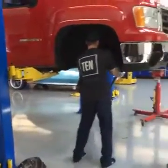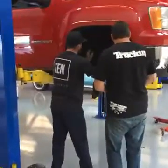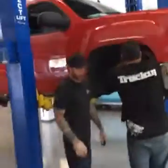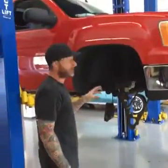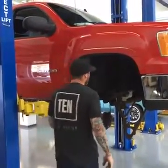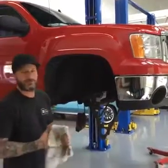I don't remember what side. I wonder if we can. You can't turn the coil. I was trying. I think if I. Might just have to loosen it up. Might just have to loosen up the strut a little bit. What's happening is the coil spring on the strut is interfering with the bolt, so you can loosen everything up, but you just can't slide the bolt out enough to get the upper control arm completely out. Sometimes it shows it doesn't matter how much prep you do, you still run into little issues.